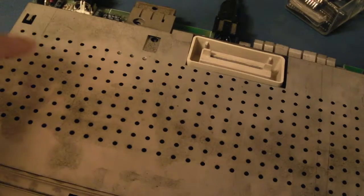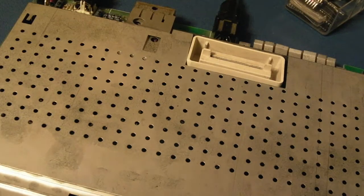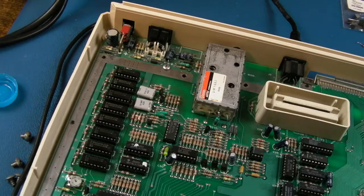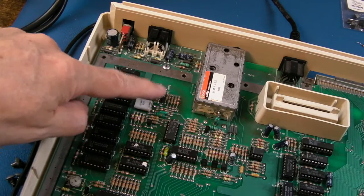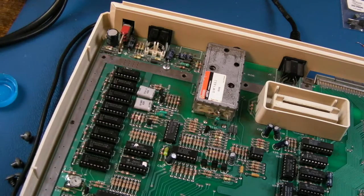But I think I sort of showed you to start with. I was heating it quite a while and there was no effect, so actually I think those transistors were just a little bit temperature sensitive. So the final things that seem to solve this colour stability, obviously, we're swapping these transistors and that one. I obviously had to swap these a second time because I don't think the ones I've got are genuine.